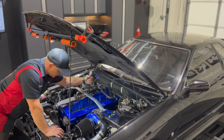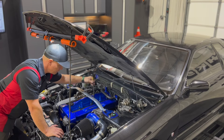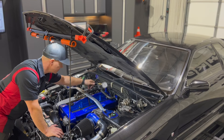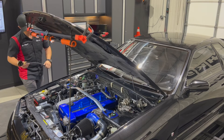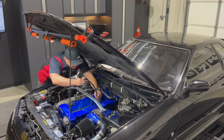Number three came in at 175. It's important while doing this to stay consistent in your methods — I try to keep the engine spinning over the same number of times and work as quickly as possible since the engine will continue to cool down. But running it up to operating temp means it won't lose temperature so fast that the rings will shrink up on us.